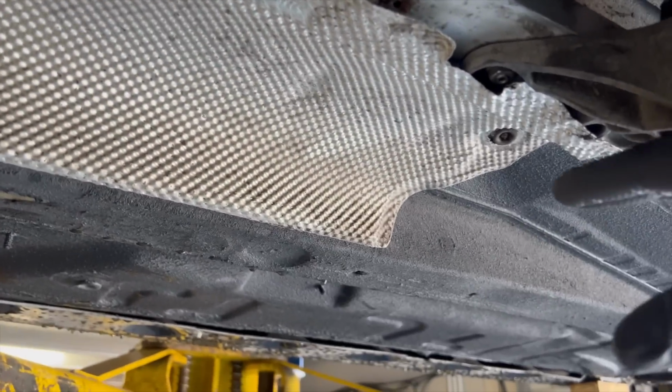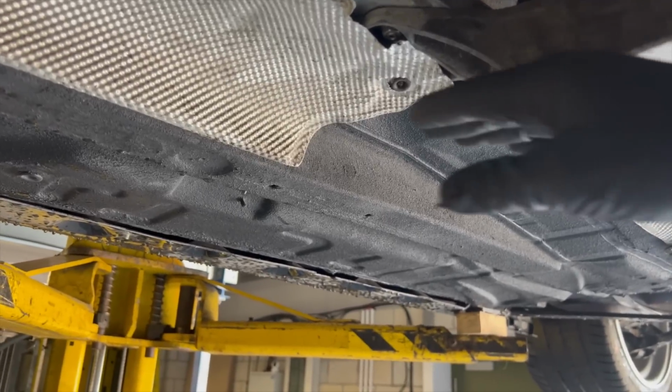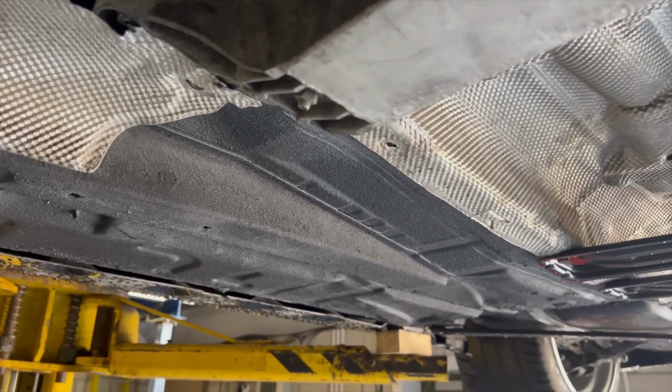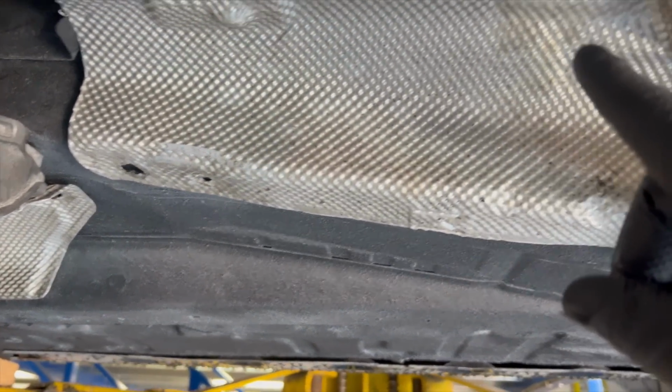It's going to have to flatten off a bit, which we've discussed, and I'm perfectly happy with just flattening 3.5-inch pipe for this small section here. It won't bring it down to like 3-inch volume or anything like that. It'll just give us the ground clearance that we need to come past here and up into here.